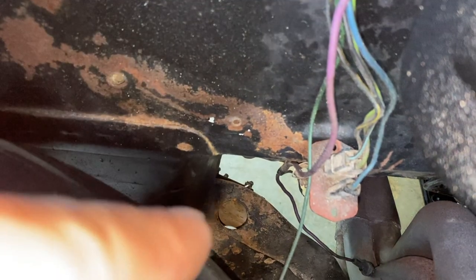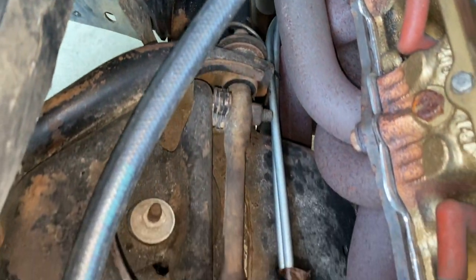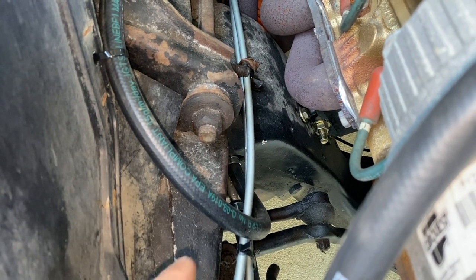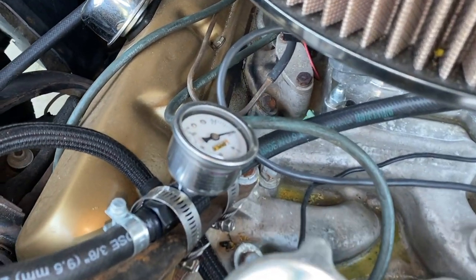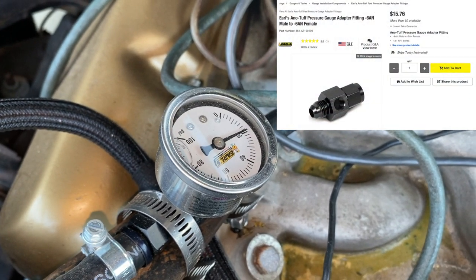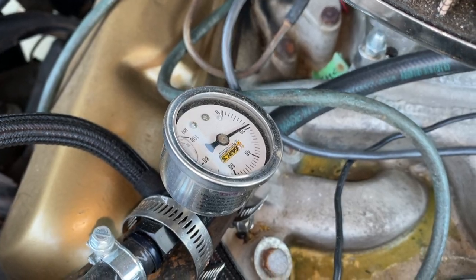You can see down there on the frame where the two hose clamps are — where the hard line meets another flexible line and runs through the frame like the OEM one does, all the way up front. You can see the two lines coming out, and I have one line that runs all the way up to the Sniper system — that's the return line. The other line comes up over top the alternator, and I have a fuel gauge that tells me the pressure so I can make sure I'm getting the right amount of fuel pressure. While it's been sitting it's leaked off a little bit, but it does have about 20 PSI from the last time I ran it. And then you can see that goes into the inlet.